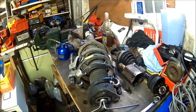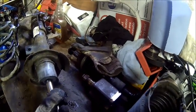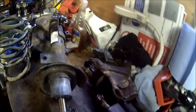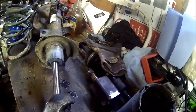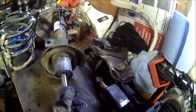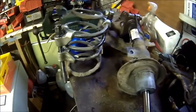Take that out and you can take the whole thing out and fit it to a new one. You can certainly see these shocks are pretty worn - I just push it in and there's not much resistance going on. That's exactly how it felt when I was driving. You can also see there's a considerable amount of wear on one of them, so we've got to fit some new ones.